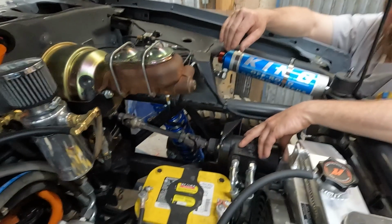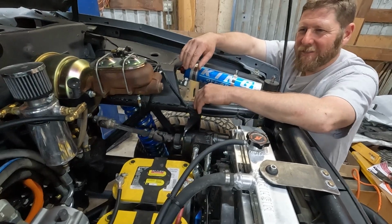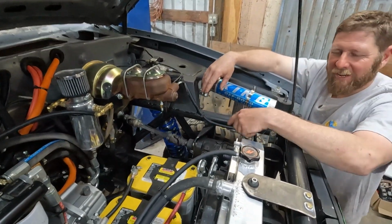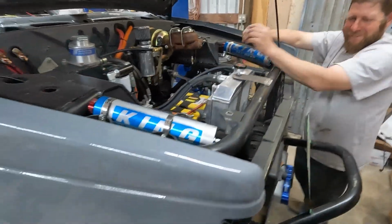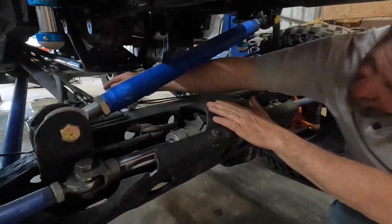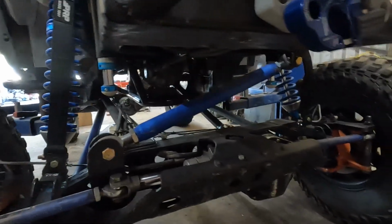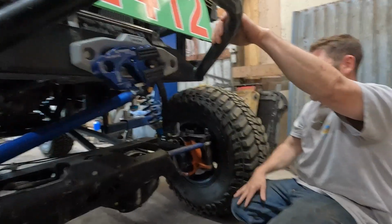This is your orbital. So there's no mechanical connection between steering and the axle and the wheels. Nope. So you've got your reservoir that feeds your pump, feeds your orbital, feeds your steering ram that's on the axle, and it all return flows through a cooler, through the filter, and back in the system. That's so cool. It's on a closed loop. And then there's your steering ram, and here are your two hoses running up the upper link to steer it. I've never seen that before, and I think that's just the coolest thing. It's something we've been doing in the off-road world for quite a while. Well, it's a brand new world to me, so I'm really impressed.